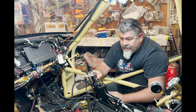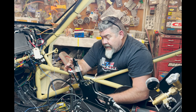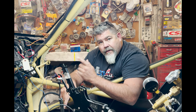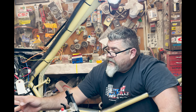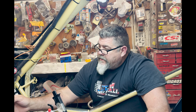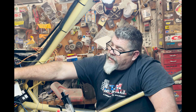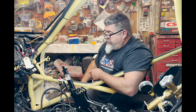This is all for my trans brake, the sensor on the rear end, and my dump valve. I talked to Zach again about our scramble buttons — you ground one side and run it to the input, and when it sees ground it tells the box. This plug here goes directly to the G-meter. These two go to the G-meter, these two go to the plus or minus on our grounds up front. These are all inputs and outputs — one side's one, one side's another. We used all of them already.